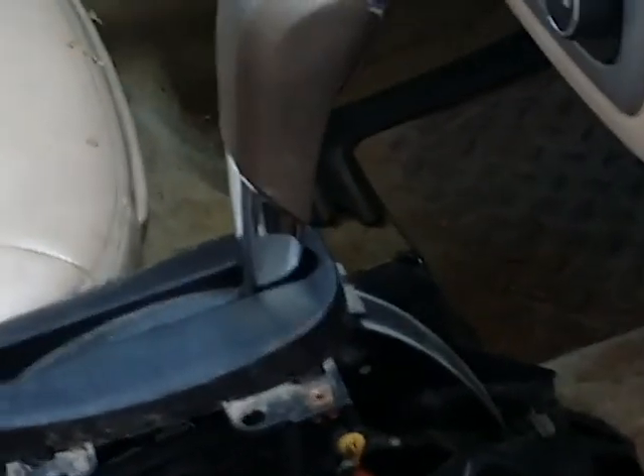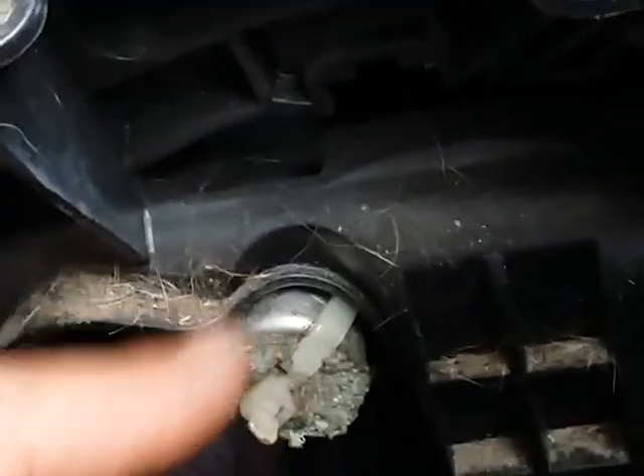Hey YouTube family, Paul Phillips here — got an issue with an '08 Chevy Impala. The first time it happened, the car wouldn't come out of park when I depressed the brake and tried to release the shifter. There's a little solenoid here that's supposed to move, but the wire breaks on these every time you move the shifter. When you move the shifter the entire plug moves, bending the wires like bending a paper clip back and forth — they're very light gauge wire, I think 20 or 22 gauge.